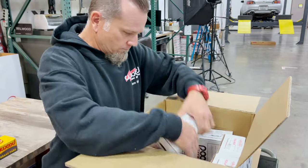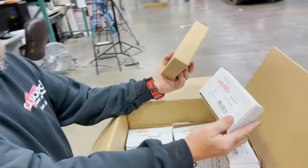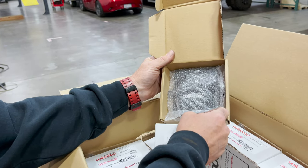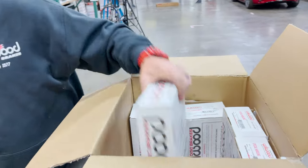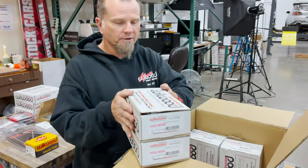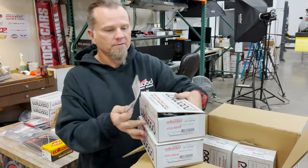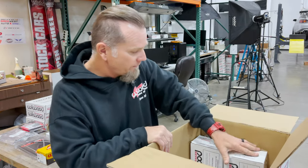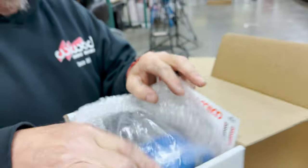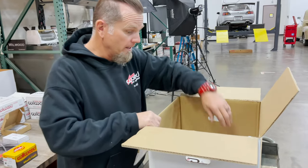The BP 20 is what we're using in the front of this car right now because we've been autocrossing. All necessary bolt kits, hats. This kit comes with everything needed to set up the electric parking brake system — it has the controller module, which we're going to mount after we get the brakes installed, the switch, and the full wiring loom or harness. You're going to notice there's going to be two calipers on each rear corner: one for stopping — these are in competition blue, our forged narrow super light four-piston — and then the electric parking brake calipers in the same finish. These kits have been doing really well for us, and it's working out great for everybody building super high-end custom cars.